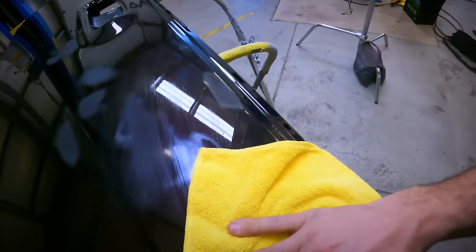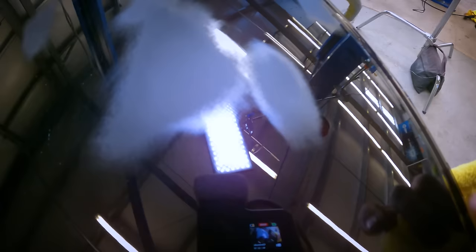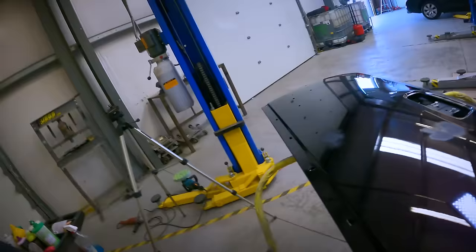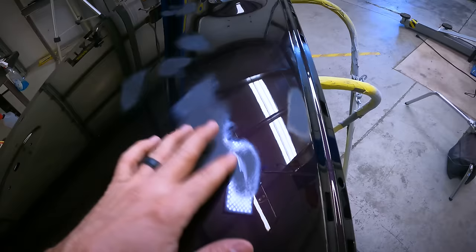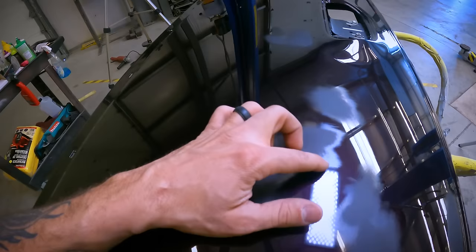Have your microfiber on hand. You can see the nib used to be right there in the center and now it's all nice and leveled out with the surface around it. If you're going for a factory finish and just want to chisel the nibs flat but leave the orange peel and texture, that method is really good for not knocking down a lot of the orange peel so you don't wind up with a weird flat spot — and the rest of it is all factory orange peel. This is what I'll normally do for a collision repair job where you want to leave the texture. I'll even most of the time use a 3000-grit square block to level it out instead, because that won't knock down any of the orange peel around the nib.